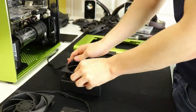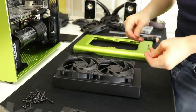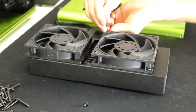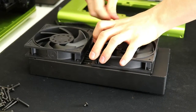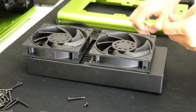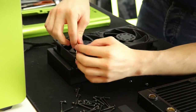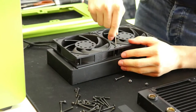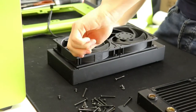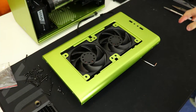As for the final and arguably most important part of the watercooled build — the radiator — this is where we find out if the larger radiator can fit. To reduce the complication of the connection to the rest of the loop, the radiator is going below the fans. Rather than hold the radiator with fans balanced on top and slot long screws through both top panel and fans, we're taking the slightly easier two-step approach: first secure the fans to the radiator with short screws. To align all the radiator screws with the fan screw holes, I sometimes use long screws to guarantee alignment, then use short screws in all other aligned holes to secure that alignment, and then replace all long screws with short ones — giving you eight connections between the fans and the radiator, which is more than enough. The unit is then mounted to the top panel with eight fan screws.